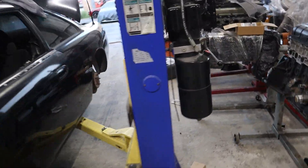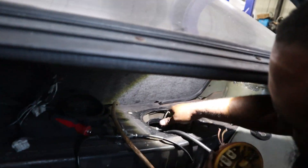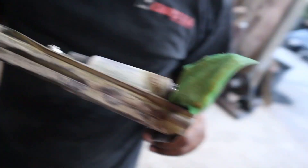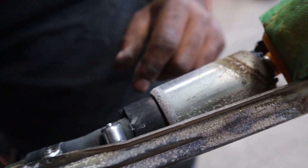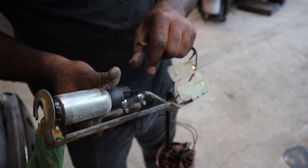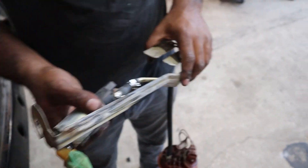Progress update guys. I'm wiring the trigger kit. I'm not that motivated, but I'm going to do it regardless. Nick, we pumped all the gas out and we figured, hey man, might as well pull this out and see what pump is in here. Let's see what we got. This thing is from the 80s so it might have... Wow. What the hell is that, Nick? Melted rubber? What pump is that, bro? That's a tiny pump. That's not even a 255. It's swelling. It's garbage. I think I got a fancy top hat over there somewhere. We're going to change that. We're going to put a bigger pump, put another top hat. I'll finish wiring this up and then we're going to get it started.